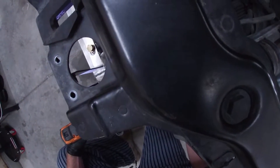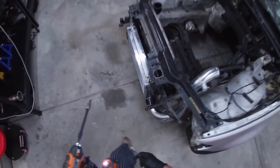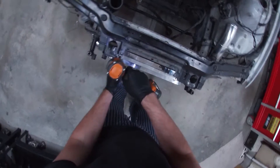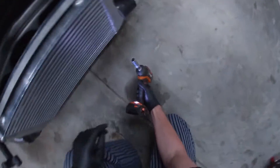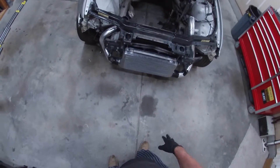You just need a 10 mil socket and 10 mil wrench. Make sure the washers don't fold. Don't go too crazy. Then grab your T45 extension and 13 mil wrench — this one's a little tricky. You're going to have to feed the wrench awkwardly behind, but then you can tighten it down. Same deal on this side — wrench through the back side, make sure you're tight. Swap your 13 over and tighten underneath. And there you go — it's on, it's done, it's ready to go.